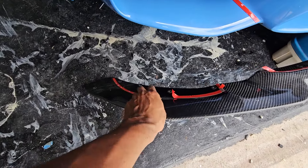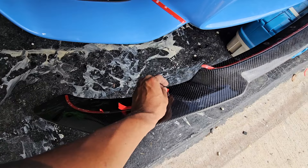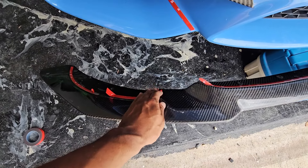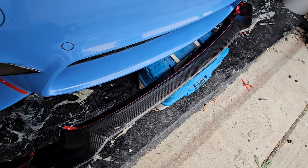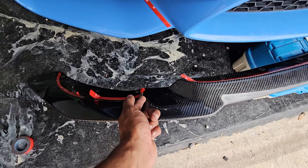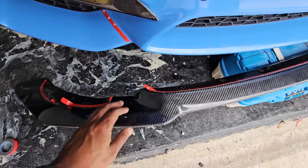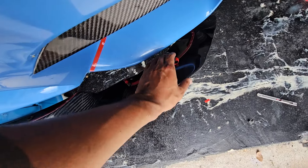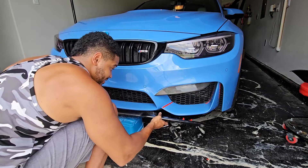Excuse the ratchet setup for keeping this mount - I couldn't find my other jack. Everything's been mounted up, cut, and preset, so now it's time for probably the most painstaking part - once the 3M starts sticking, everything can go to hell very quickly if you do it wrong. In my personal experience, the best way is to peel some of the 3M up and curl it out so once it's flat you can pull it and easily have it done. I did go ahead and clear bra all of this - it came out really good at first - but I pulled up one part and forgot to put it flat so now it's starting to peel, so I'm going to cut from here through here to keep it good.